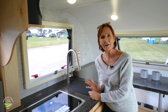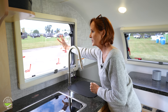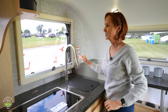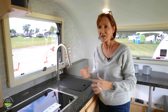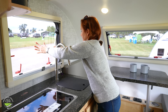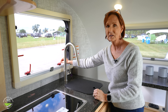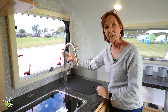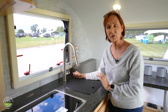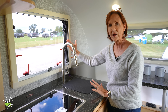I love these acrylic windows — they're so easy to use. Just lift up the handles and push the window out, and the entire window opens. If you just want a little bit of breeze, you can tighten it up and leave the window at that location. You can also open it completely and set it at whatever height you want. There are little latches at the bottom, and when you're bringing the window in, you can snap the handle in the middle, which leaves a little airflow but still locks the window into place. Be sure not to travel that way though, because air can come up through the window and remove or damage it. Always make sure the latch is completely on the inside when closing to travel. It's also a good idea to open the screens and blackout shade completely when traveling, so they don't have any movement going down the road.